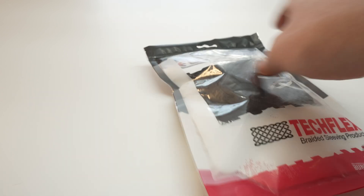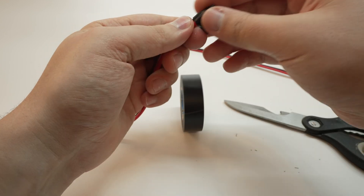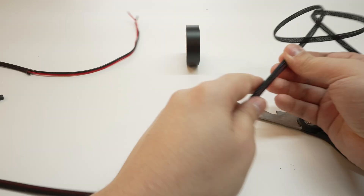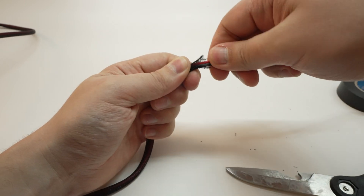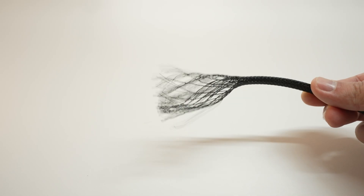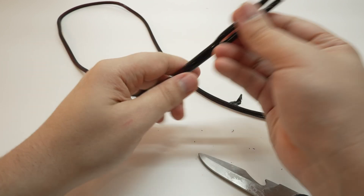Next step is to add the sleeve. We're going to use a 6.4mm or ¼ inch Techflex expanding sleeve. First, I add some electrical tape to bind the two wires together so it will easily slide through the sleeve. I then just feed the wire through the sleeve from the point where the wire splits to the exact same point on the other side. When you reach the other end, cut the sleeve making sure not to pinch the wire. Add some electrical tape to fix the sleeve in place and make sure it doesn't fray — these things fray like crazy if you cut and let them be. Next we will install the cable pants, the 6mm variant, making sure you are also covering the sleeve with the cable pants.